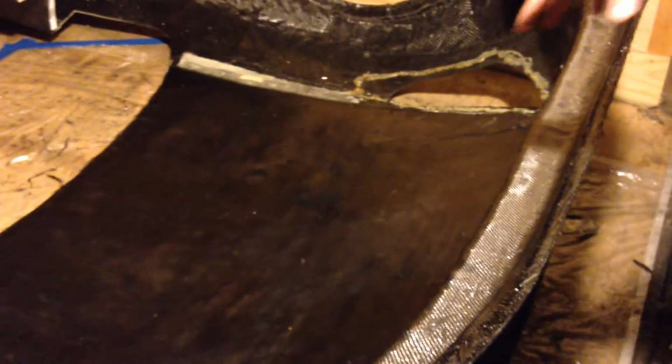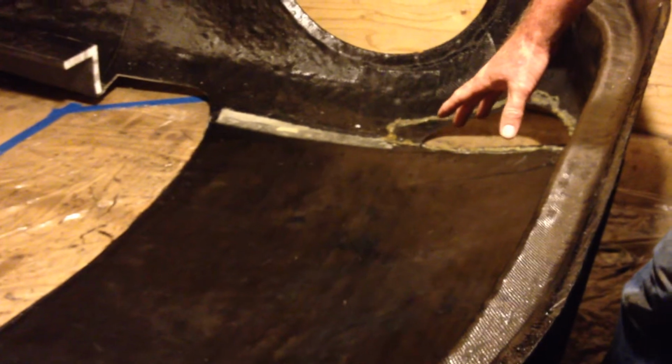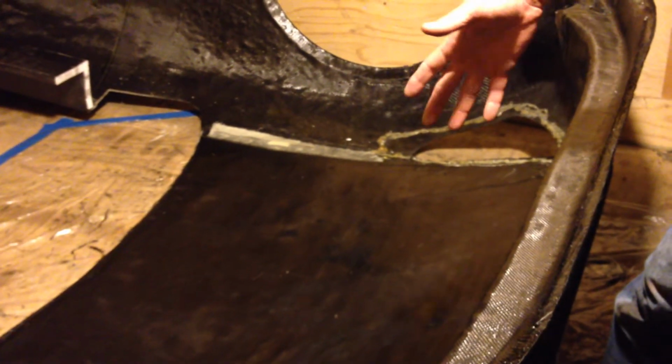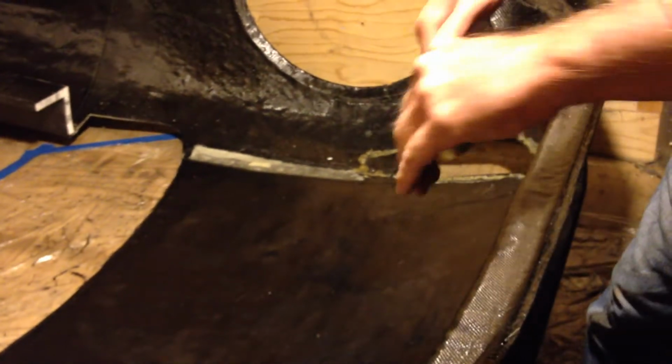Oh yeah, Tom, how did you, Matt, and Erica get it so smooth? Because it is gorgeously smooth. Honestly, we cut 2 pieces first to cover the air dam, and then another one there because we were worried about that, and we had great success with that. So then we went for it with the biaxial stuff, and just laid one continuous piece over, and it wrapped in and just laid. Oh, you know what we did first? Before we laid anything down, we wetted it out.